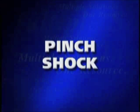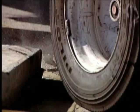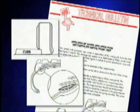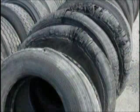A pinch shock condition is the next effect discussed. This occurs when the tire is sandwiched between the wheel and a blunt object such as a curb. This damage can vary in magnitude, starting with a light crease in the steel sidewall cables — generally not a reason to scrap the tire. In a more severe case, the wheel can damage the guide rib and lower sidewall area. Look for wheel damage as well. In addition, there can be internal damage to the tire, such as a tearing of the rubber products between the carcass and crown plies, as well as the creation of a radial split condition. Both conditions, without careful inspection, could be overlooked and create a separation later in the tire's life.